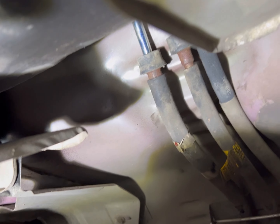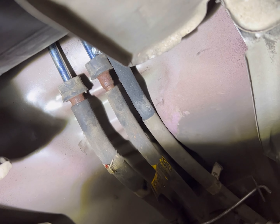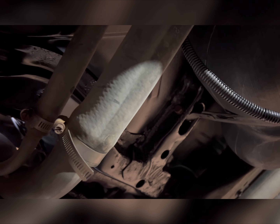Lines are clicked on there - it came with a new plastic fitting so I just removed the old ones. Vent tube, I just slid it on there and put that clamp on. It's stretched out a bit but it's just a vent tube, it's fine. Heat shield's back on, straps hooked up. Last thing is to put that nut on each side, then plug in the connector. I did put some dielectric grease in there - I found it. You can see it in there. If you don't have any, get some and put it in there.